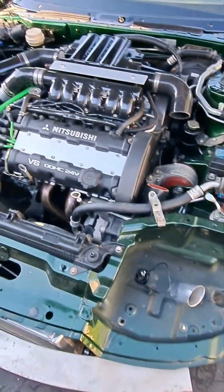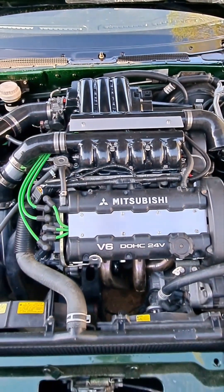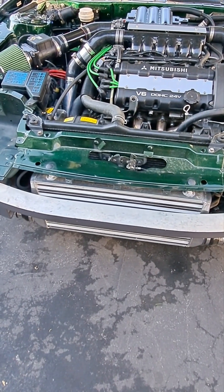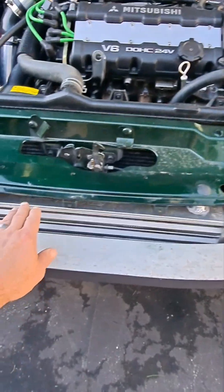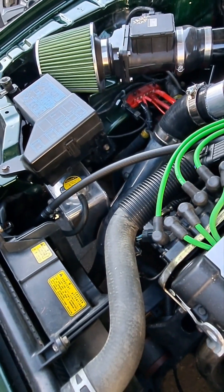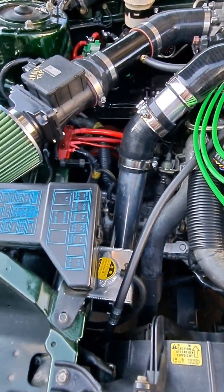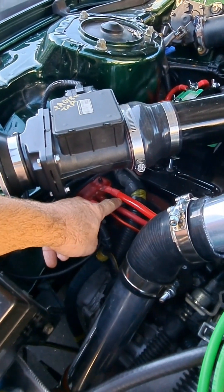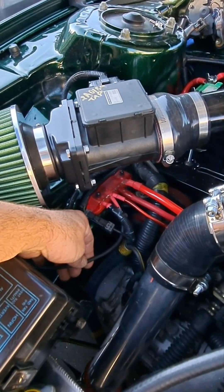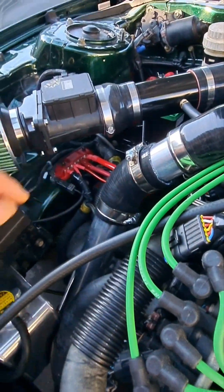Next video I'll have this running. I made some custom plates to clean up and cover the wiring. Since I did the intercooler, I had to eliminate the stock coolant reservoir — it sits right underneath here — so I bought an aluminum 2-quart reservoir and mounted it down in the extra room since it's naturally aspirated up top. I also bought a power distribution block: my batteries come in there, amp wire, hot wire for the fuel pump, power wire for the ignition, wire to the starter, and I grounded it straight to the frame underneath.